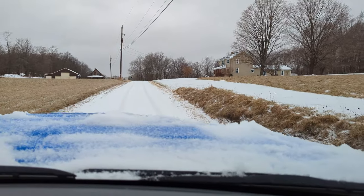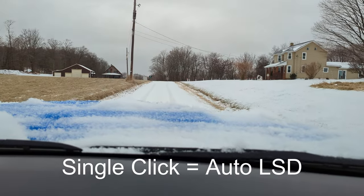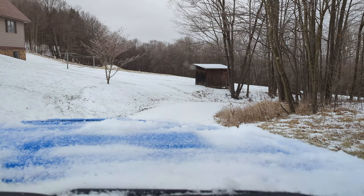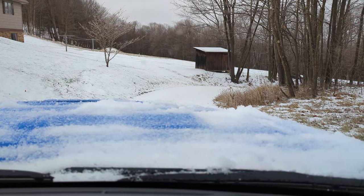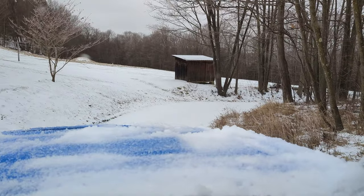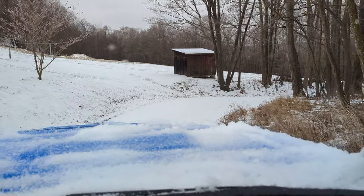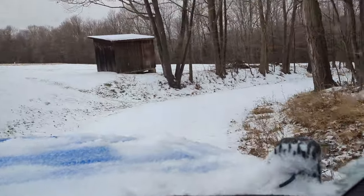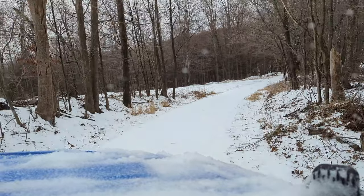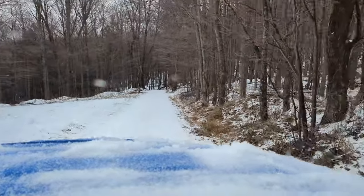We're sliding a little bit — this is two-wheel drive. I'm going to go ahead and shut off my traction control because it is fighting me. We're going to turn that to the first setting and see if that helps me — and that's helping significantly with keeping the power to those back wheels. It's pretty slick right now, so I don't want to have to deal with four-wheel drive when I'm already stuck. So I'm going to go ahead and put it in four-wheel drive now and shut the traction control the rest of the way off so I have full control over the truck. Just because it is pretty slick, and now we're kind of going into the off-road section. There's no reason to be slipping and burning up the tires — we could have made it easily, but I don't feel like eating up my tires spinning when I don't have to.